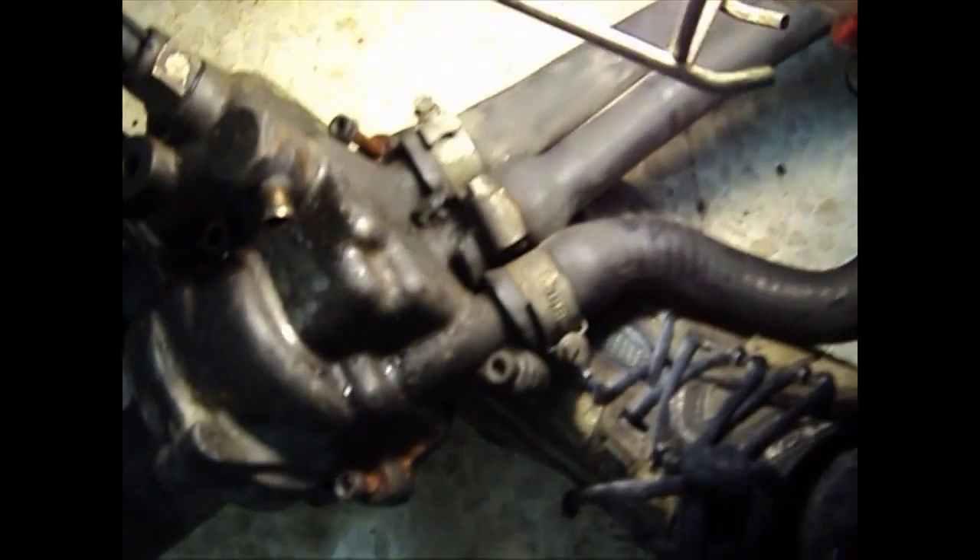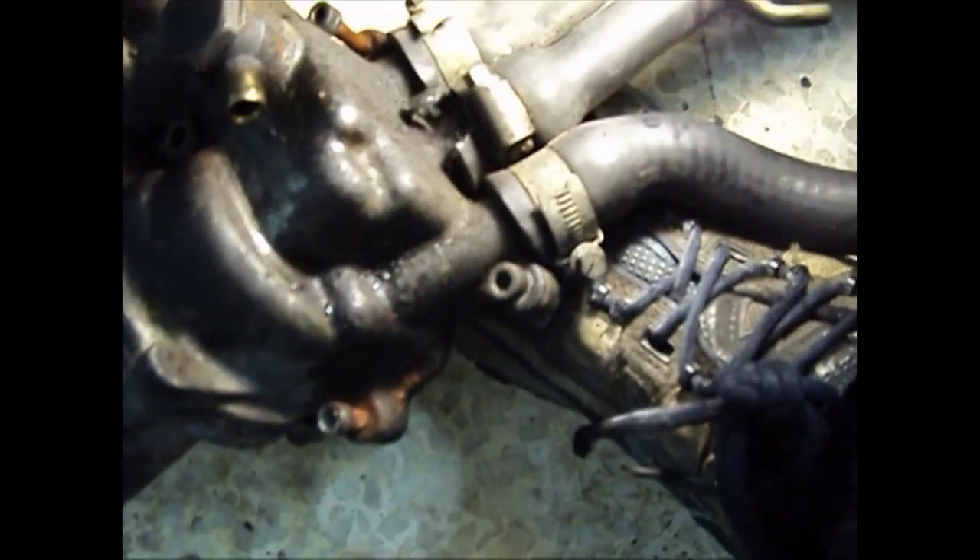The thermostat is fairly new, that's why it's still shiny. Now the pipes — looking at them with some light — these pipes are heavily damaged. This isn't a standard pipe that fits one size; it looks like it may have been homemade with a reducer. This pipe was blanked off to the heater of the dashboard, I guess because it had popped at some point. This car was bought used, so a lot has happened to it.